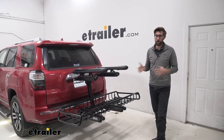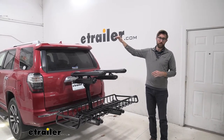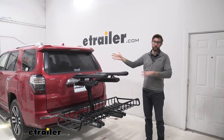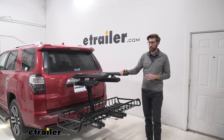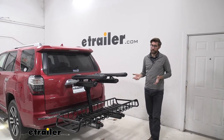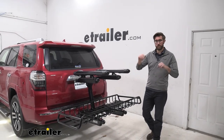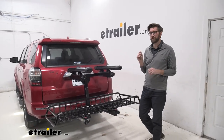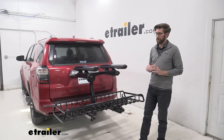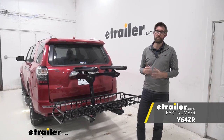Overall I think this is a really great solution for carrying all your different gear on the 4Runner. You've got this big vehicle you're probably filling up with a lot of stuff — whether you don't want to get on the roof rack in snow, want to keep skis lower so it's not as dangerous to load, or you've already got a box up top and are looking to maximize more space on the hitch. It is really big and really heavy so moving it around when it's off the vehicle is kind of a hassle — probably going to take two hands. When loaded up it is a little heavy on the passenger side due to the swing-away arm, so be mindful of lining up properly when getting that anti-rattle bolt in place. But that's a small price to pay for being able to have all kinds of different gear swapped out on your 4Runner. That's going to do it for our look at the Yakima XO system on our 2015 Toyota 4Runner.